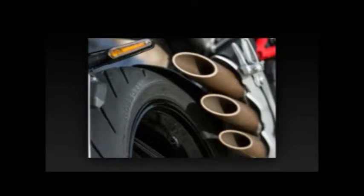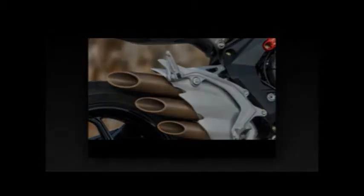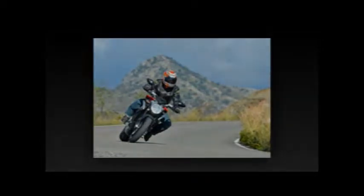R&D Technical Director Brian Gillen, who was also head of MV's World Superbike/Supersport squad while he was in charge of the Brutale and various other projects, points out that MV's racing data reveals its riders are at full throttle only 12% of the time even on the racetrack. It's acceleration off corners and mid-range power that matters. New cams, 3 liters more exhaust capacity, and a new airbox to complement the new ECU tuning are the big changes for the Euro 4 version of MV's excellent 800 Triple.